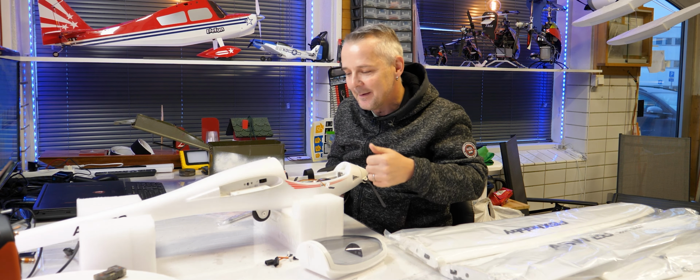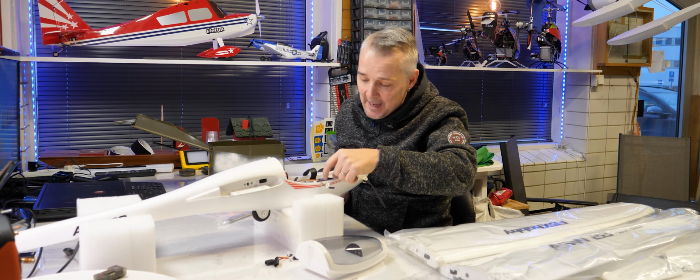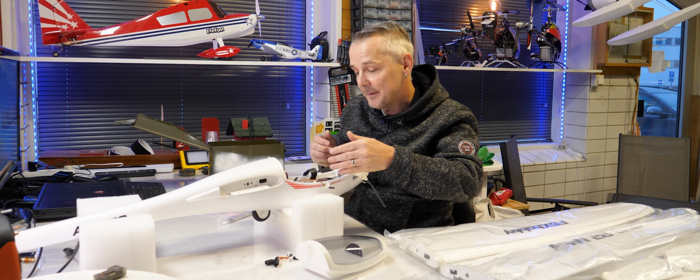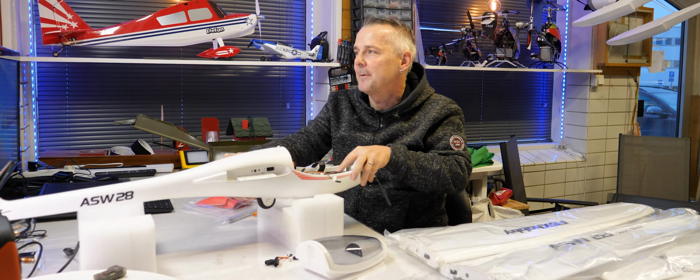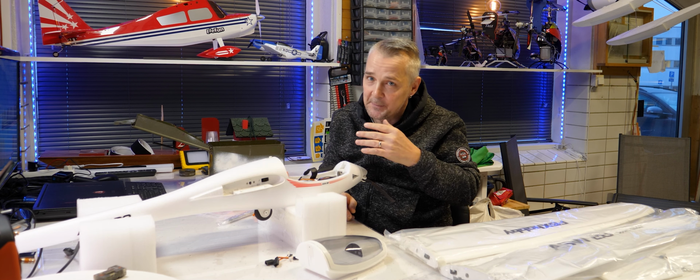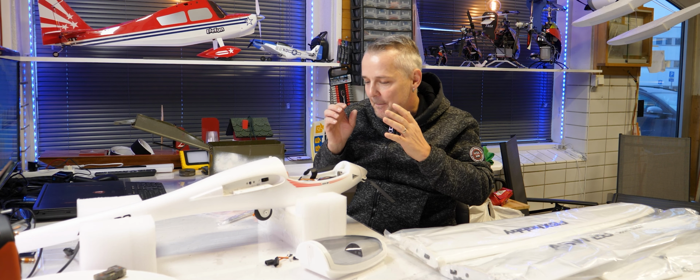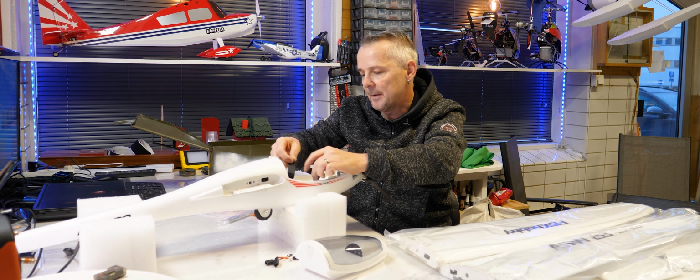And you can even, if you remove the Velcro straps, which occupy almost a centimeter together on both sides, you will be able to even put a bigger battery in here. So check this out. No problem. So 4000 milliamp, it will be. Of course, we need to check the CG and everything. That's the first thing we are going to do. But that's now sorted out. We can use that one.